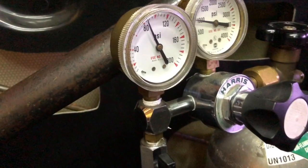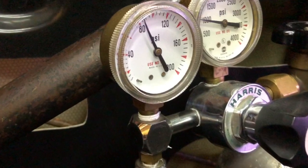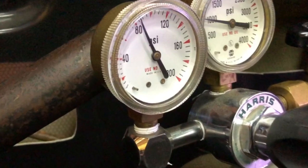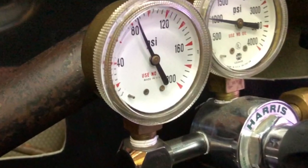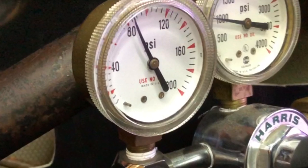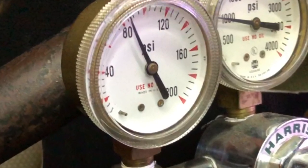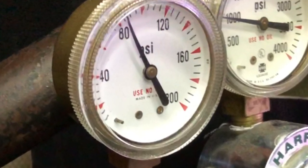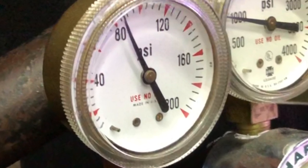CO2 pressure does not always 100% follow boost one-to-one. You may have to put 50 pounds of dome pressure on the waste gates in order to get 20 or 25 pounds of boost. Sometimes it does follow one-to-one — if you've got 40 pounds of dome pressure you'll have about 40 pounds of boost. What seems to be happening when it stops following one-to-one is an indication of how your turbo is doing. Once you get to a point where you suddenly have to add 5 or 10 pounds of dome pressure to pick up one pound of boost, go back and look at your back pressure — most likely it's starting to increase, and that's the indication you've almost run out of turbo. It completely depends on your setup and how everything is matched together.